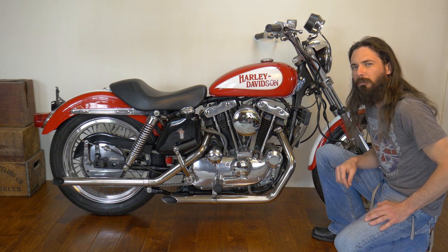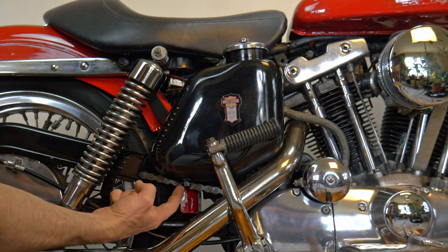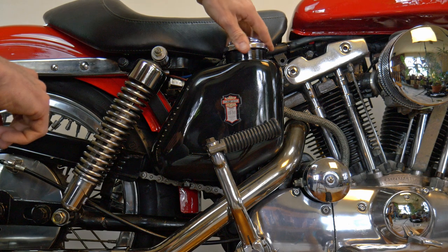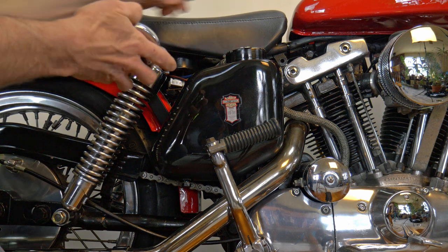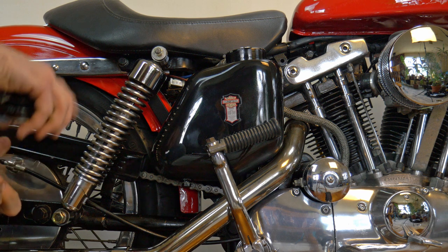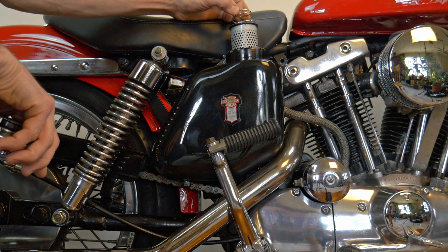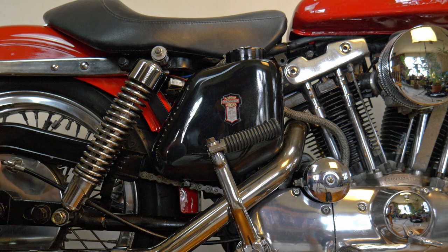The engine oil tank is on the right side of the bike, and on the bottom of the tank there's a 5/8-inch plug that drains the engine oil. In the top of the tank, under a chrome cap, is the location for the oil filter — it just lifts out. On some bikes it will be a paper element inside a removable canister; on others, like this one, you'll find a single unit that's a metal canister with an integrated paper filter that you replace as a whole unit. I'll show an example of each style and put part numbers in the description.